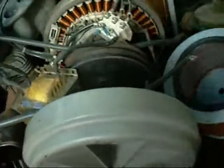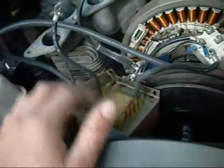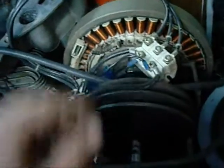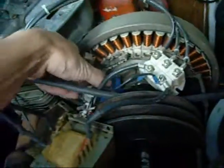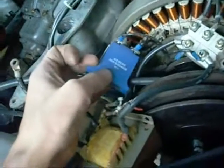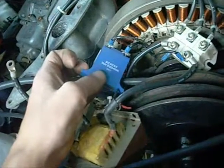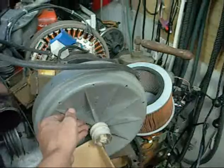It's working alright though. This is the twin Smart Drive setup I made a while ago — I haven't had much time to play around with it but I will soon. These choke coils and things are out of a VFD — that's a three-phase rectifier. I want to feed the three-phase output from one of these into a DC rectifier brick like this one here and see what I get out of it. It's also got a little suppression device and cap on it — a one microfarad, one thousand volt polyfilm cap, and a Semikron SIOV B32S 460A package, which could just be a suppressor. That's the same motor as what's in the machine at the moment.